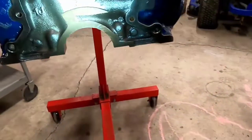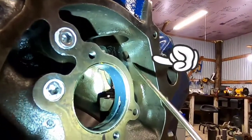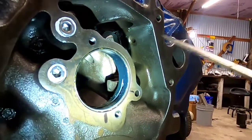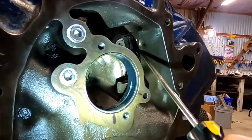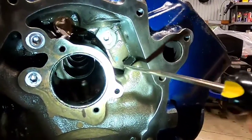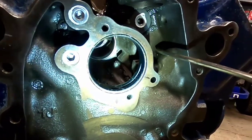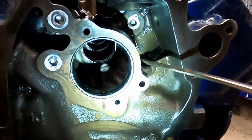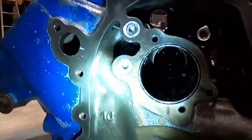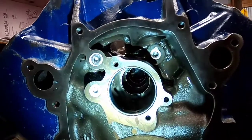On the front, right here is oil drain back from the head that comes back through the deck - this is how it gets back to the pan. I radius this edge and sometimes cut a little groove in this area, because this is also where the distributor gear gets oiled. Same thing on the other side - radius that drain back so oil comes back and drains out as easily as possible.